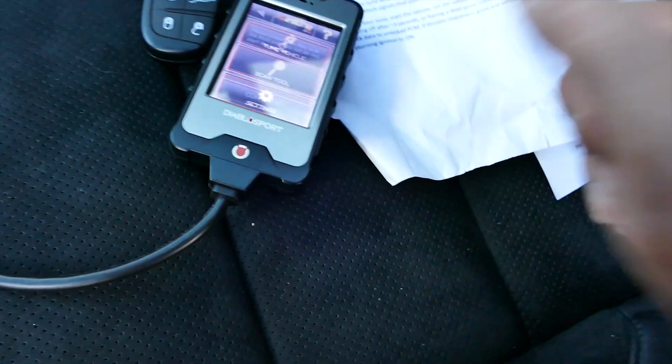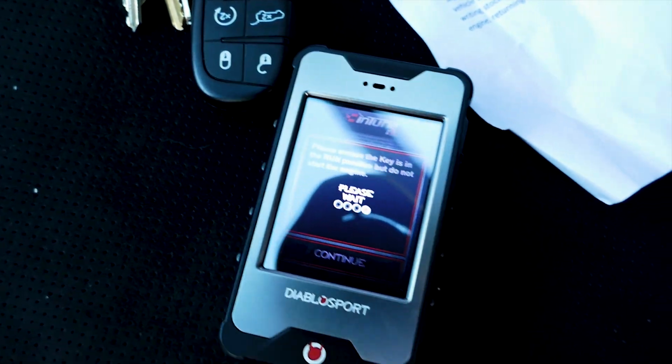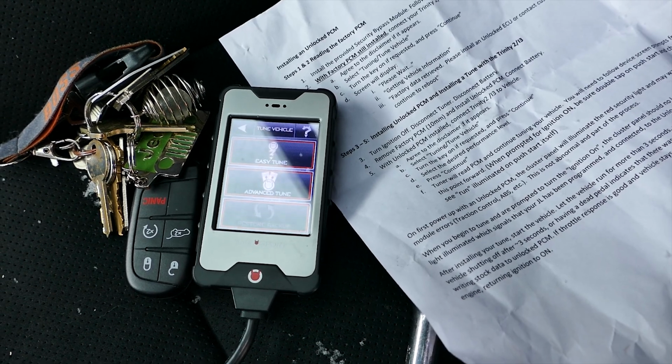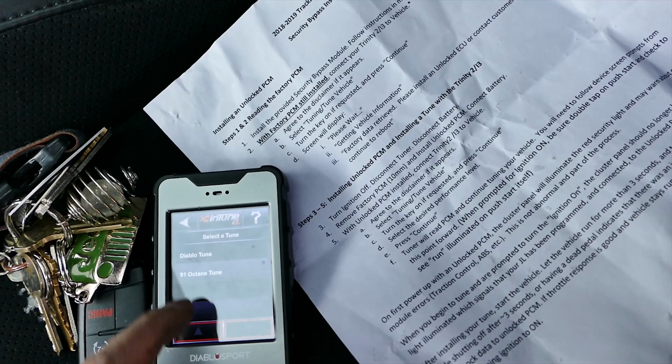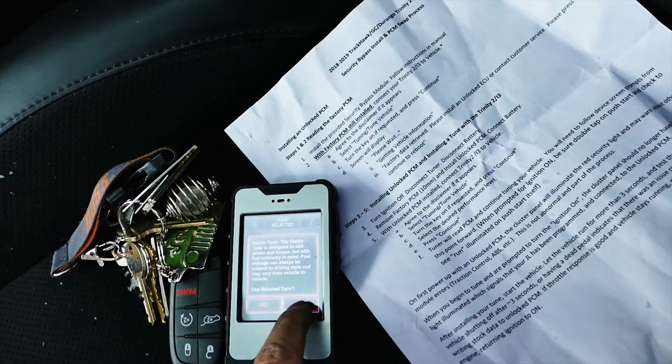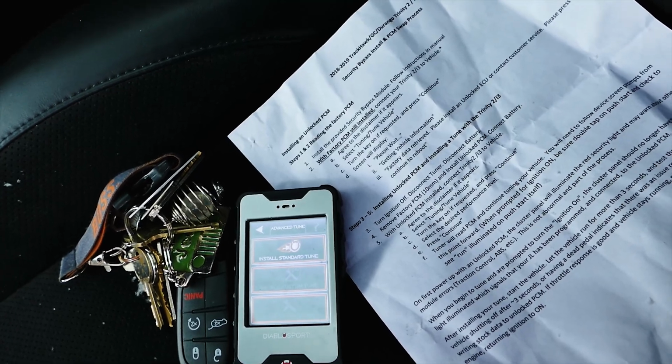Next, hit that Tune Vehicle tab, in which the tuner will ask you to cycle the Mopar into the run position, but do not start the engine. Next, hit that Continue button on the tuner. Once the next menu appears on the tuner, hit the Easy Tune tab and choose your desired tune. In the next menu, choose it again and hit the Yes box on the disclaimer box. Alright, next one's a little confusing, but follow me here.